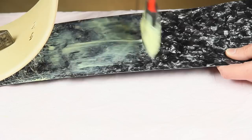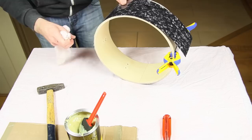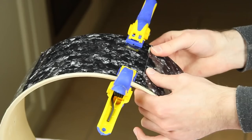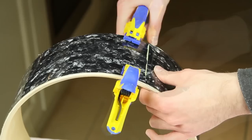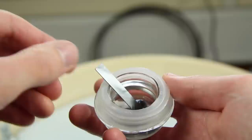It is really important to push out the air bubbles by using a piece of cloth or a roll. The big advantage of gel glue is that the screw holes do not have to be taped from the inside — it will most likely not happen that the glue floats through and rinses the inner shell. It is best to not use too much glue on the very last bit, as most of it will squeeze out. Use a paper towel to get rid of it immediately. Do not use acetone — it will remove glue but also dissolve some kinds of plastic.